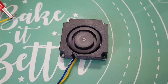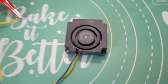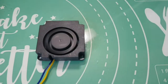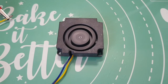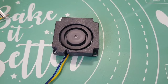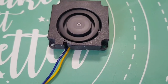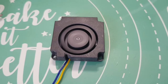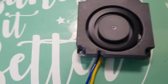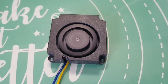Here's the fan put back together and despite breaking the wire it does actually appear to be working. This is running at 6 volts at the moment on the power supply. If I crank this up it's actually quite quiet - I can't really hear it. I'm going to turn the power supply up to 12 volts... still spinning strong. Let's take this now up to 18 volts - it does seem to be quieter than it was. Looks like the oil has helped.